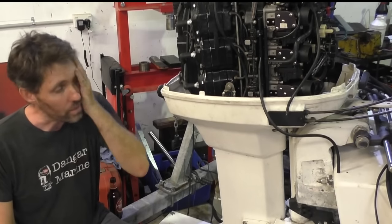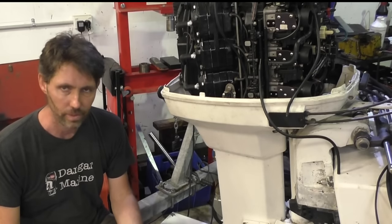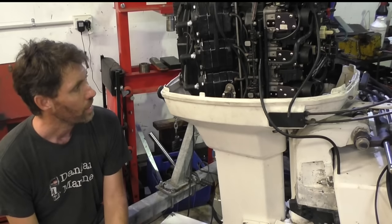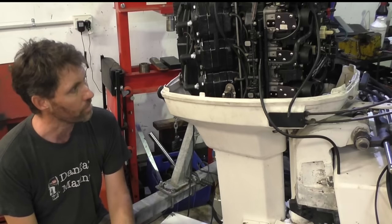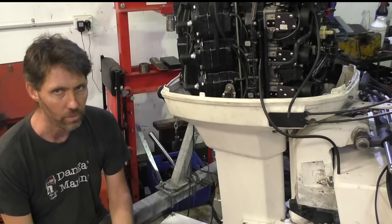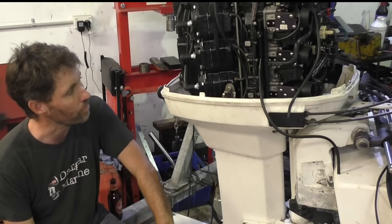My big concern with this motor — well, there are two big things. Whenever you build a motor, you think you've done a good job, but it's always a bit nerve-wracking when you first turn it over. Is it going to run smoothly, is it going to fire up? Not too worried about that, but just whether everything's right with the bearings and all that. Making sure no rings have got caught — that's the thing that makes me a bit anxious about starting it up.